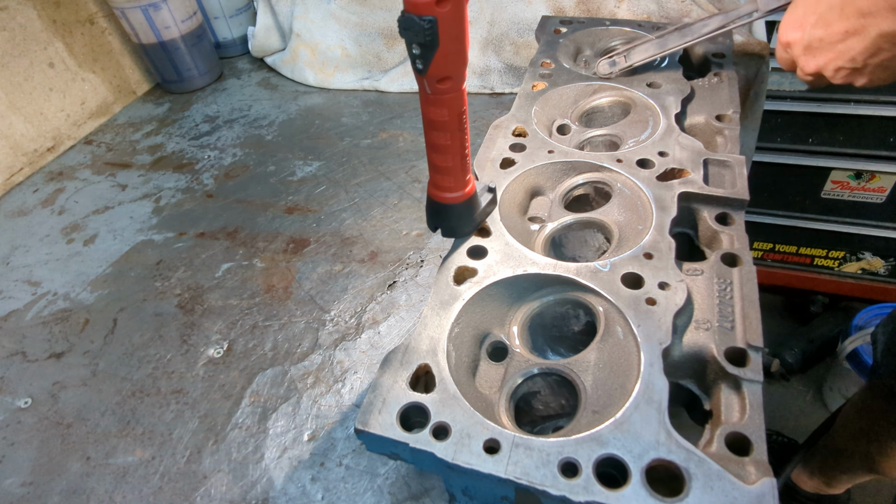One thing I'm going to do here is get a piece of metal, probably something kind of thicker, and weld it in here, because I don't want that heat coming from the exhaust in there. One other modification I'm going to do is drill these out and tap them for, I think, quarter 20. That's some carbon that came out of the heat crossover port back here. I chipped it out, and there it is. See how this heat crossover port is almost completely plugged off? I'm going to clean all that out and weld something in that one too, so you don't have the heat going into the intake manifold and screwing anything up.